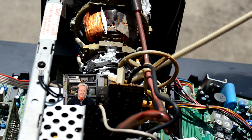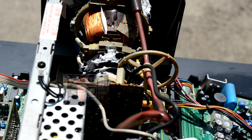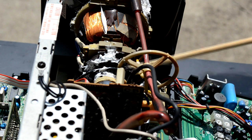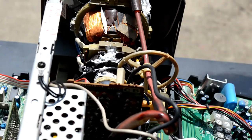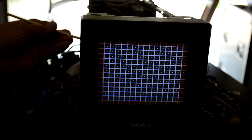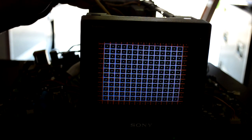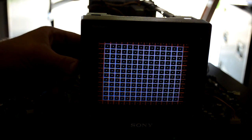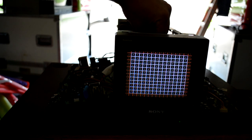Again, this is very tricky. Once this hardens, there's really not going to be much of an opportunity to go in afterwards and make any real adjustments to the screen. I'm going to take a chopstick and use it to smooth out a lot of that epoxy, then move my yoke into place for final set. After a couple of hours, this RTV will completely set and we'll only be able to make another adjustment by basically cutting it out and starting all over. So I want to make sure I get it right the first time — that's why even after applying the RTV, I'm going in here and checking again to make sure my adjustments and screen are set to a good setting.